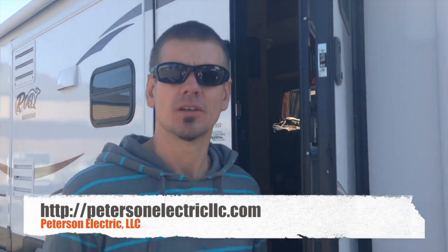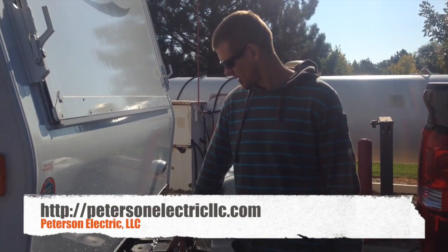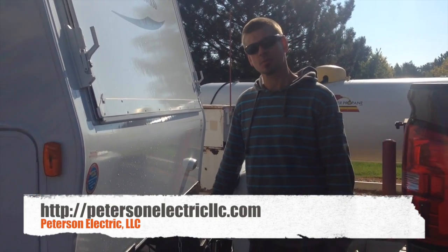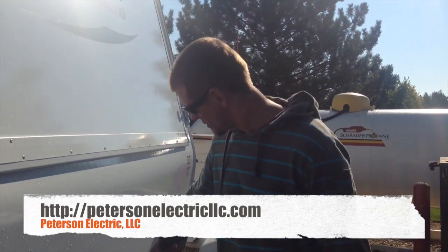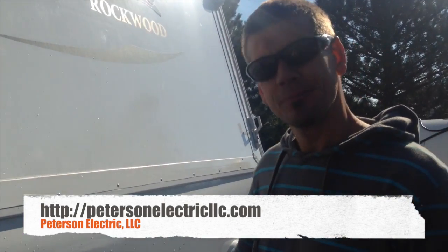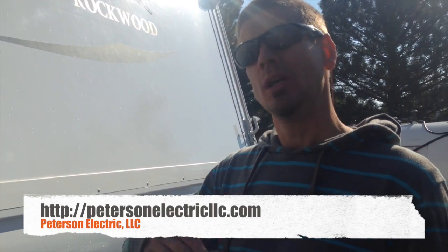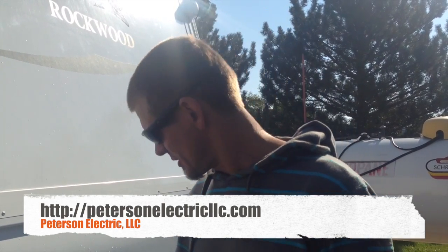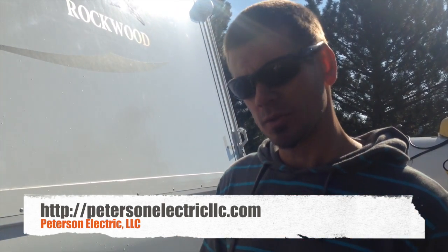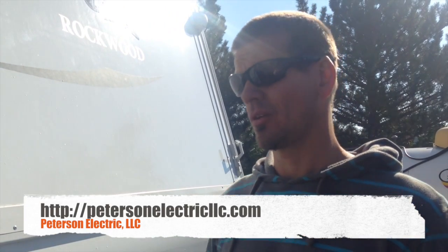When we bought this RV, we did what the RV guys suggested — we lowered our voltage on our batteries. So instead of one big 12-volt battery, we put two 6-volt batteries in series. It's interesting because in the AC world, going higher in voltage lowers your current, but here we lowered voltage and by putting them in series, we actually doubled our amp-hours.